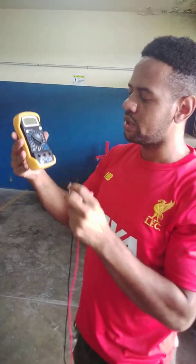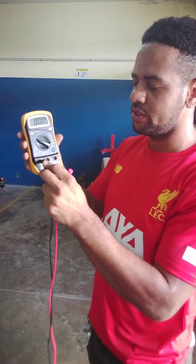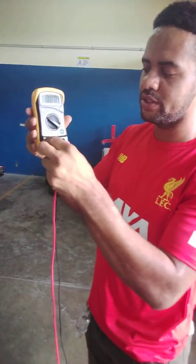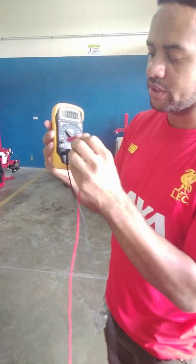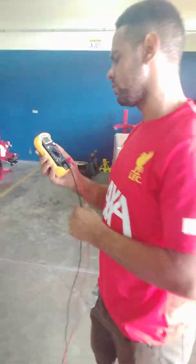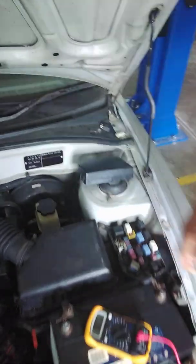So the black one always should go into your common slot. So insert the common lead into the common slot. Since we're measuring for voltage, we're going to insert the other into the voltage/ohm slot right here. So follow me over to the fuse box now. So we are going to connect the meter.